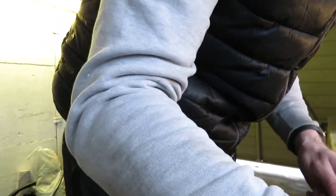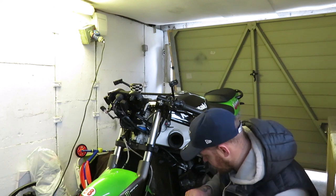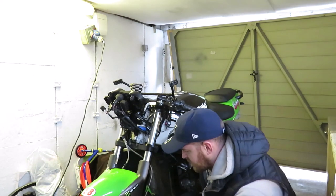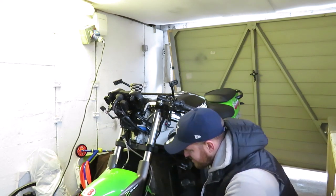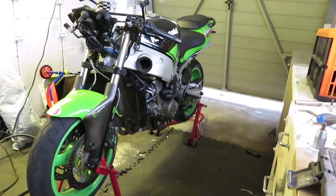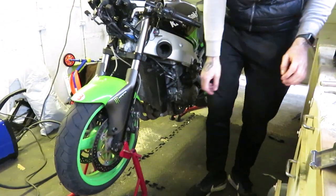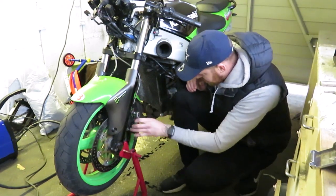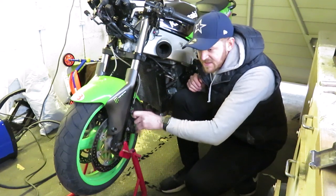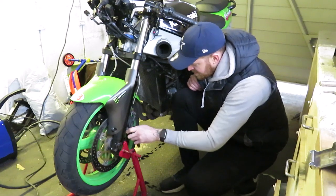14mm — yeah, 14 and 12 I need. For some reason there is a 14mm pin on the other side. I'm just going to see if I can do this. I'm just going to pump my pistons out as far as I can — I'll give you a fighting chance of using the compressor to blow them out a bit further then. So I'll do this side first, and that should help me out at least.